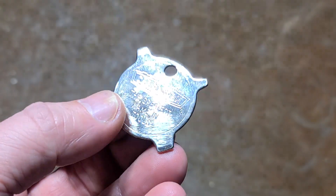A lot of times they're just a bear, but I found that a tool like this is excellent for being able to get under or on top of the various little latches and releases for wiring harnesses. A lot of them are a wiring harness block with a press lever that makes a catch over the other side of the connector, so you can press the lever and push this under the lip of it so it doesn't want to catch, and then work the wiring harness off.